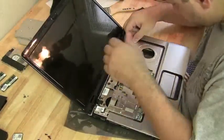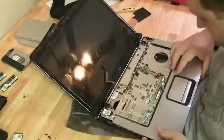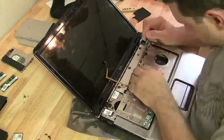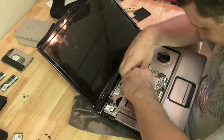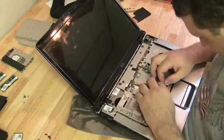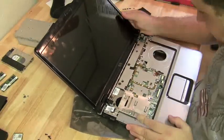I wish I could really do laptop repairs this fast in real life! You've got to feed the wireless antenna through the little gap that was created under the keyboard, and same thing for the webcam cord. Make sure everything is flush so the keyboard doesn't have any lumps when you put it back on — it all has to go back properly, nice and even.